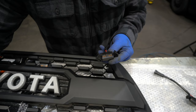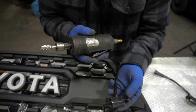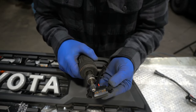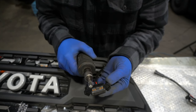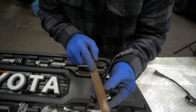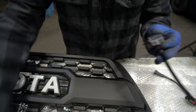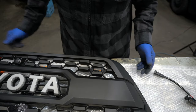On the top and bottom we need to get rid of that edge. How I went about that is I grabbed a grinder — you can use a Dremel or something like that, you don't even need that, you could use just a file. All I did was very lightly went along here to make a little bit of clearance, almost flush along there. Then I took my file and just lightly filed it, making sure not to drag it across the light. And once we've done that, there we go — now we can get the end one in.